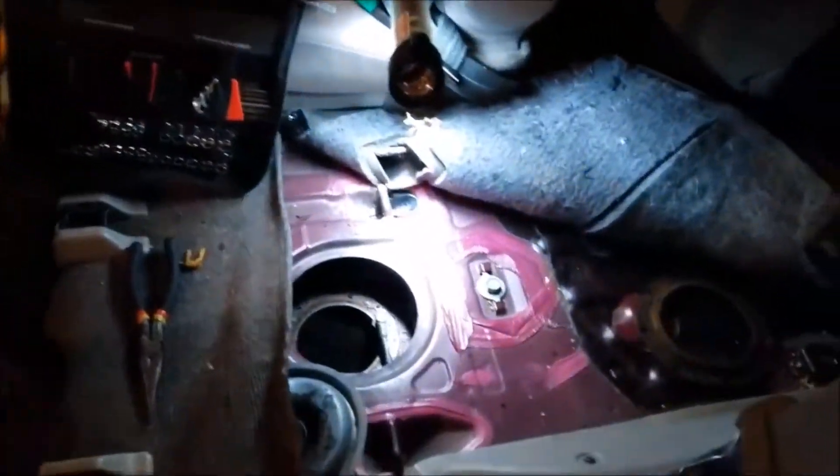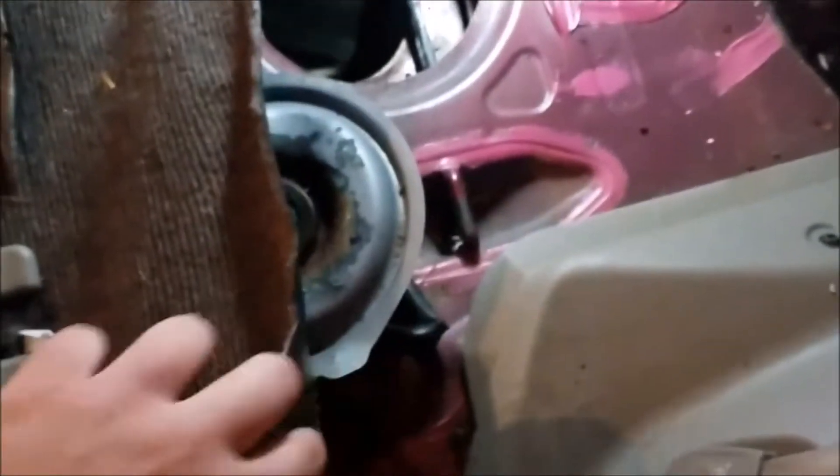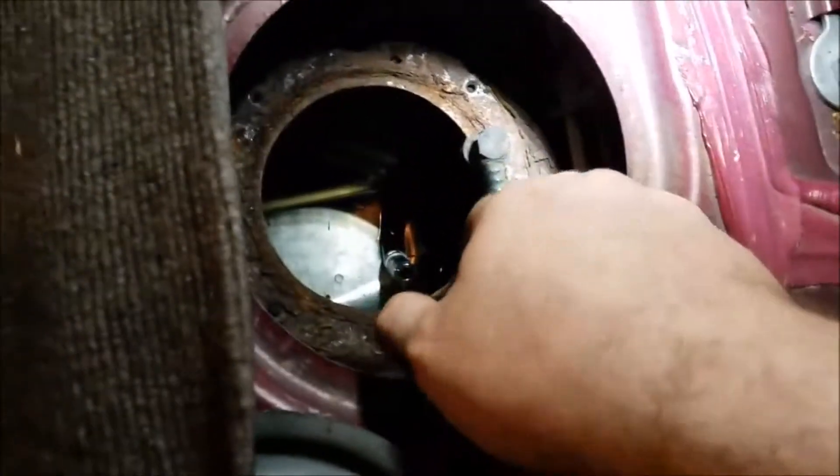In case you haven't seen it yet: the seat is held on back there — there's a little clip on the back of the seat, just release that and press up. Luckily there is an access door on this car. Take it back, peel it, and you're going to see some bolts here — they're 8 millimeters. Take them off and there will be a clip and some wires there.